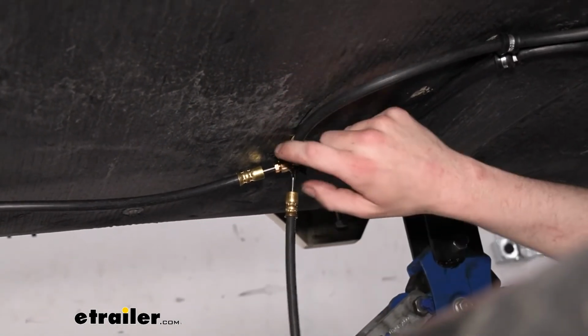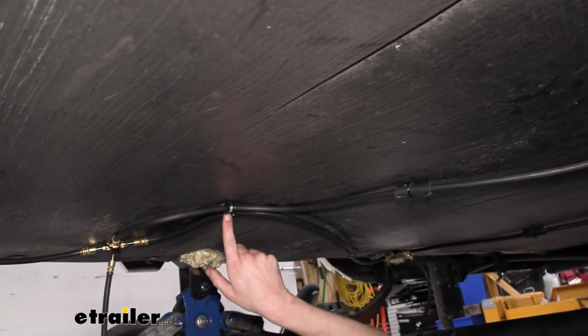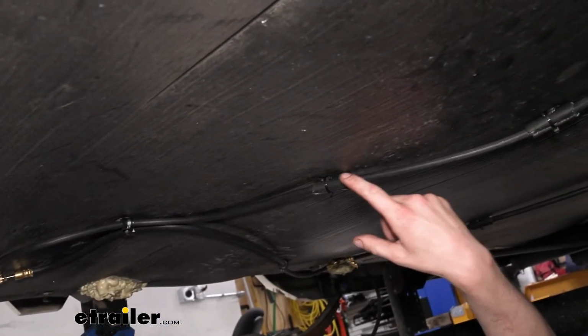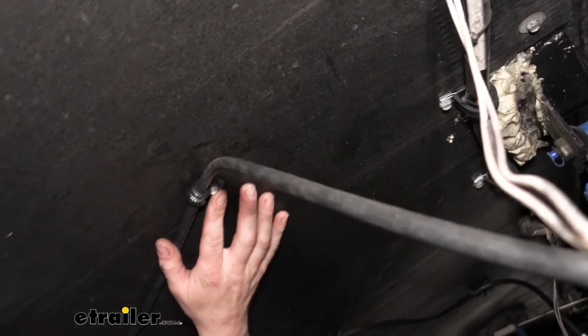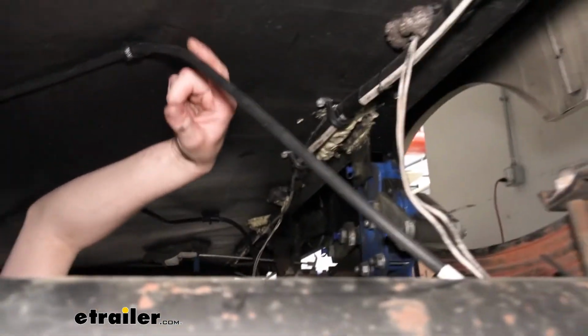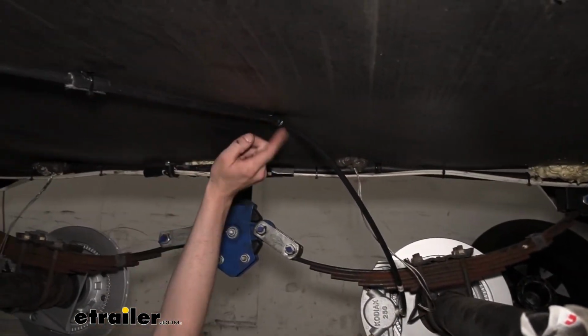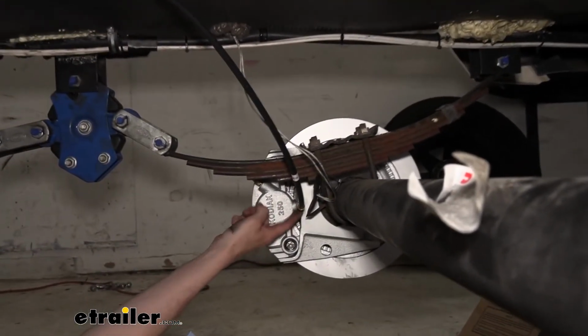You'll have two of these in your kit. These are the second longest hoses. And there was an existing bolt there, so we utilized it to clamp it. And then to take up some of the slack, I did go between the two axles here, cable tying it in place with that vacuum line over it. Found another factory fastener here that we were able to utilize, and then it just routes down to our caliper from there. We found another factory fastener here on our destination going across, so we went ahead and utilized it, and then from there it just goes down and into our caliper.